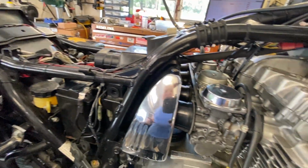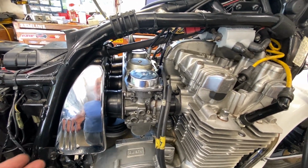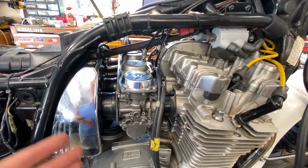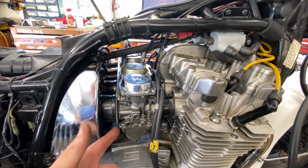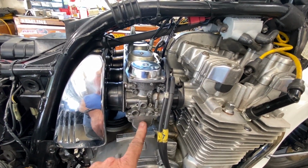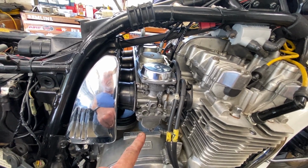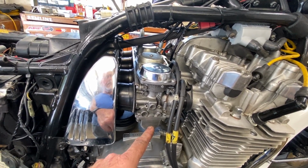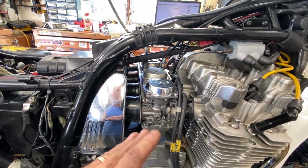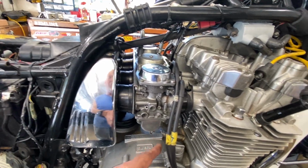But I think it's a little rich because I'll tell you right now, especially on these CV carbs, you definitely do get some influence from the slow circuit all the way through the throttle range. You really do. It's not as great at higher throttle, but if you're dragging air through and air is coming in through the slow air jet on the back, you're going to get a little influence. Just like at idle, you're going to get a slight amount of influence from the main circuit as well. Very, very small. I've been able to change lean low speed running by just bumping up the main jet, and that straightened out both the low speed and higher speed running stuff that I was dealing with in a particular carb. So it's not like you'll read that quarter throttle is where the slow circuit essentially shuts off, and it's not like somebody turns a switch off and there's like a little guy that lives in there going click.